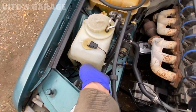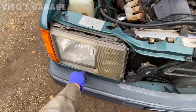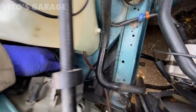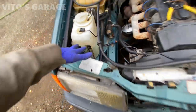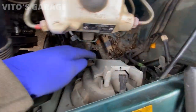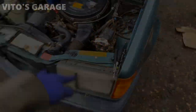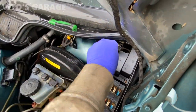For those wondering about the motors: this right here is the connector for the headlamp motor assembly. I was going to unplug it but I think they're working as they should. This is the relay that's responsible for the headlamp assembly washer, so I'm going to pull it out to verify power and ground in and out of it.